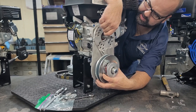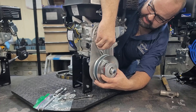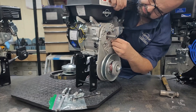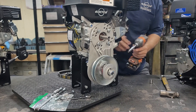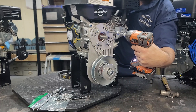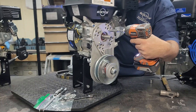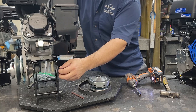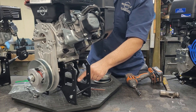We're going to get these bolts started — four bolts. The hardware comes with the CVT kit. I think they're metric based on the markings on the bolt, but they're included — use a 10 millimeter socket. Torque them in a crisscross pattern, and there you have it. The snout of the casting fits perfectly into that little cutout — almost like it was made to go there, and in some ways it was because I made it.